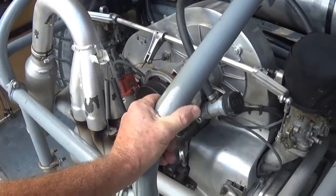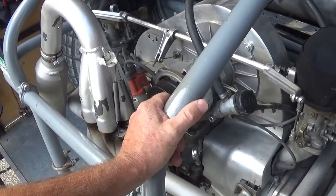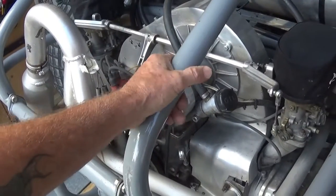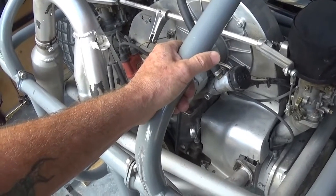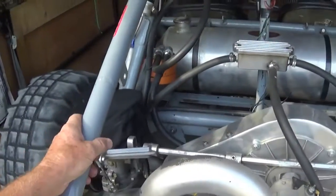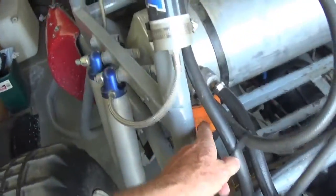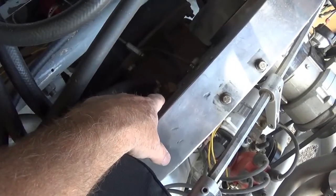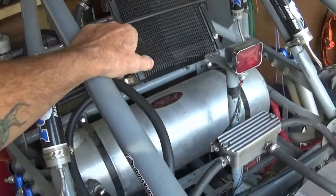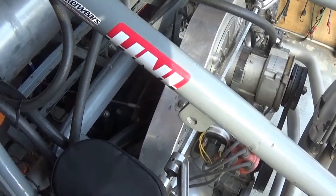I figured five days running, averaged about 40 miles a run, so that's about 200 miles. I probably got less than 10 miles to the gallon — that's what you get in those conditions turning big tires on soft sand. I have two oil filters: one on the pump, and another on an oil cooler that goes from the stock oil cooler location, through the filter, through the oil cooler, and back down to the main bearings. That setup seems to be working well.